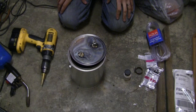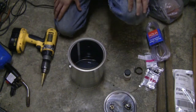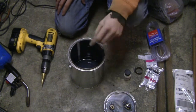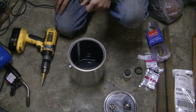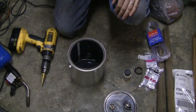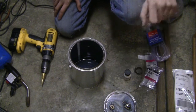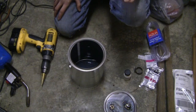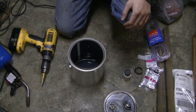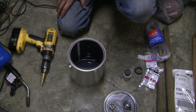That's pretty much it. You're going to throw a burning or oily rag in there, maybe drip a dash of gas or something in there to get it to light. Let it burn for maybe 30 seconds, then slam the top down and let it sit and smolder. Connect your air compressor, turn it down to around 2 or 3 PSI — maybe as high as 5 — but don't go any higher than 5 PSI or you'll start blowing seals and stuff apart in your car.